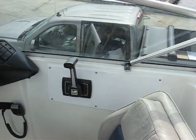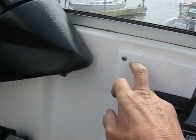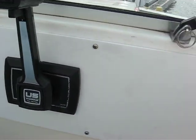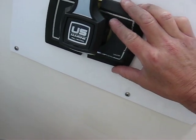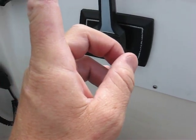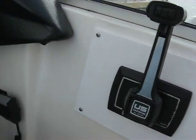If you've done any research on the kit, you realize that you have to do it. This boat came with a U.S. Marine shifter. You can see my new white mount here, because the Bayliner had an old fabric side panel where the shifter mounted — the wood was rotted out, so I built this. You pop the plate off here, pull the handle out, slide these off each side, take the screw off. You can get the shifter out from the back, and you have to unbolt the arms and flip them the other direction. Your throw is reversed. All the U.S. Marine shifters are easily done. If your boat has something else, maybe not — you'd have to buy a new shifter.